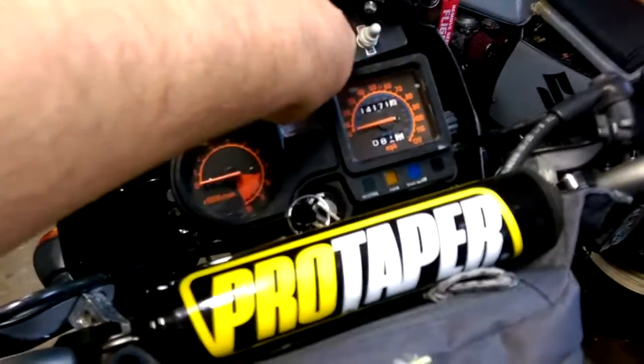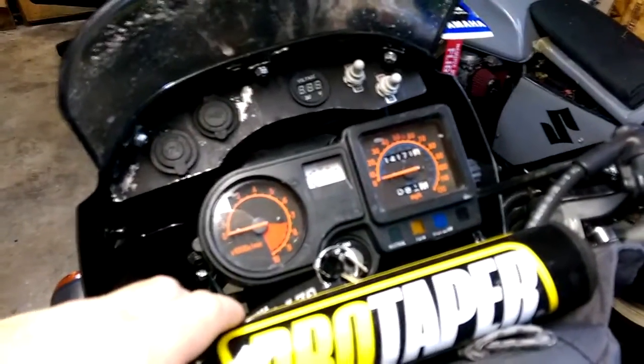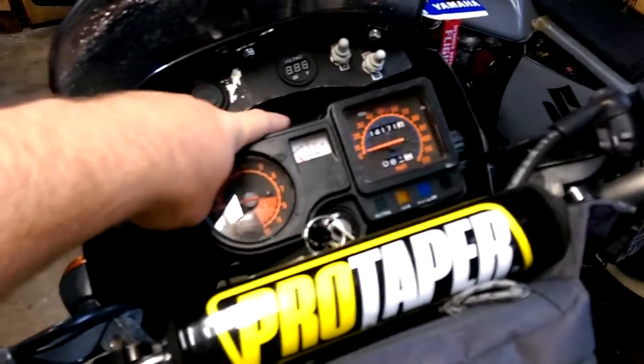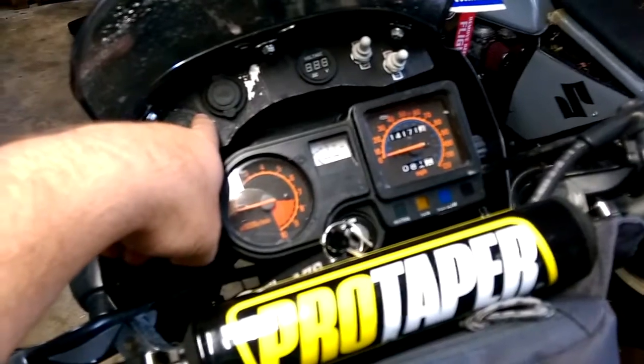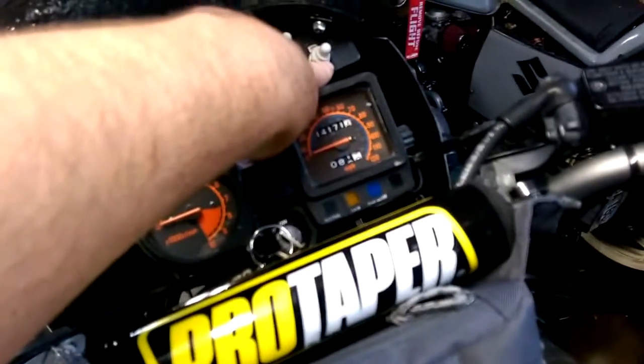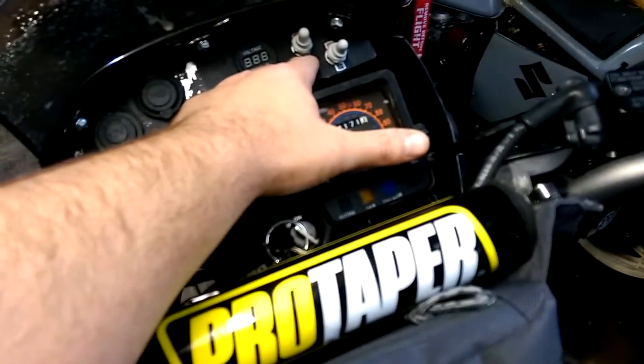There's a switch that flips all of this on so I can do this without having my key on at all. It turns everything on including the volt gauge, so you can see how much voltage you're pulling if you hook up an air pump. If you haven't ridden in a while you can flip this and see what voltage your battery's sitting at — that's really nice. I ordered these three together off eBay. The switches are normal switches with rubber boot plugs to make them waterproof. They're daisy chained into this switch, which is the kill ground switch. Everything is fed to the battery with a hot wire fused with a 15-amp fuse.